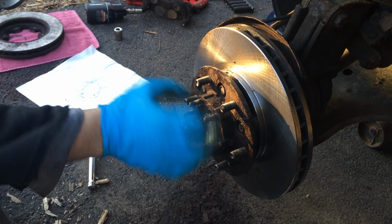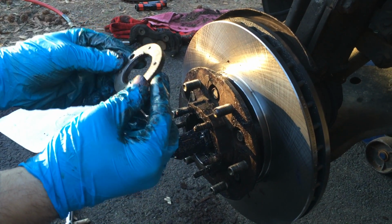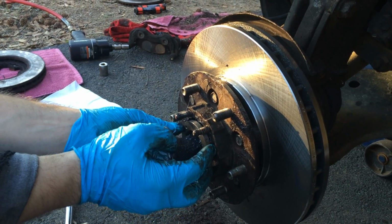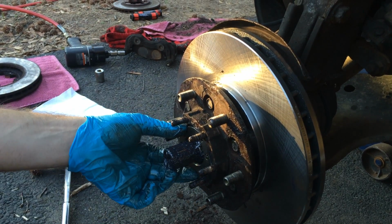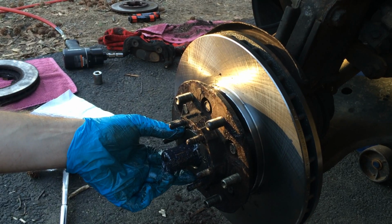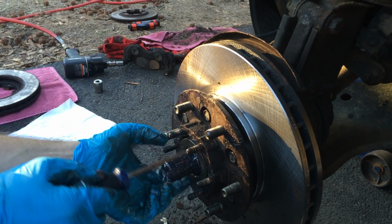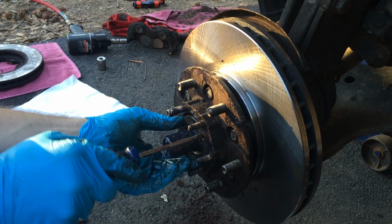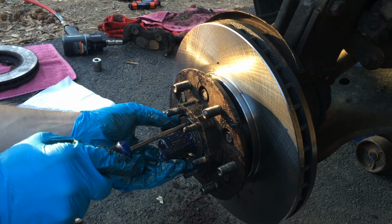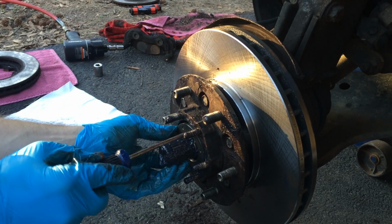After you put the rotor in and the wheel bearings in, you want to put the big thick screw that we took off earlier before, and then you want to put that back on. It's a little finicky because I don't have the right tool to actually screw it on there. But once you got the thread on, you can just screw it right on.